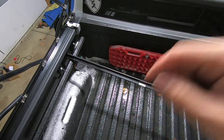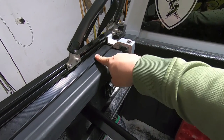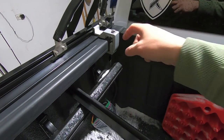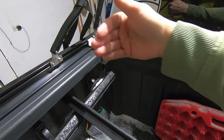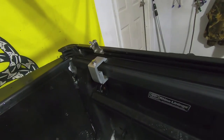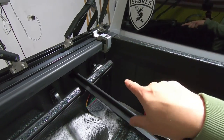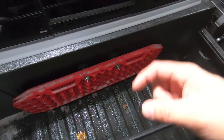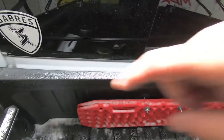Something the instructions don't call out — there's a little aluminum grooved piece on the front that looks like an extension of the bed rails. Because of how wide the RAM's bed is, it gives the clamp a surface to bite into. Without it, the canvas topper would be too skinny. This allows you to push the front of the topper out to the sides so it's wide enough to fit the canvas. Before attaching the canvas rails, we need to install the weather stripping across the bulkhead. They provide a nice solid strip — I'll use the included alcohol wipes to clean the surface, then stick it on.